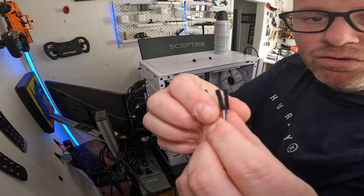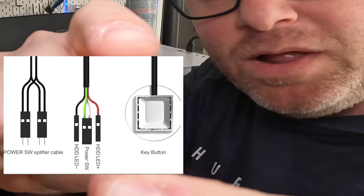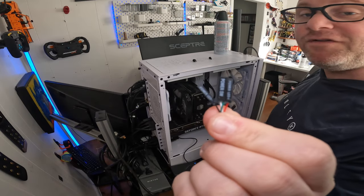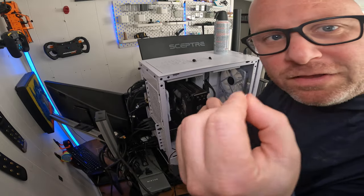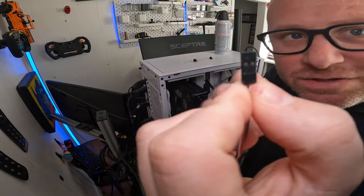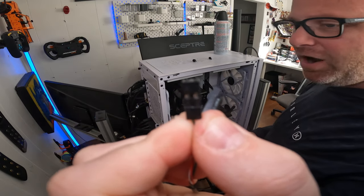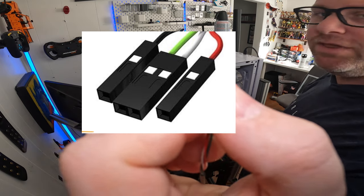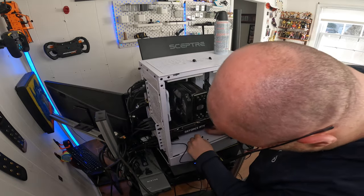On the cable, there are LED lights — you have power plus and minus — and you'll find those headers on your motherboard as well if you want the LED light. Some people may not want it. Also note there's an arrow on the connector; make sure that arrow lines up with the arrow on the power supply cord coming in. Those two arrows need to be facing each other.